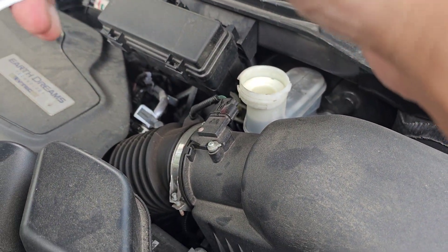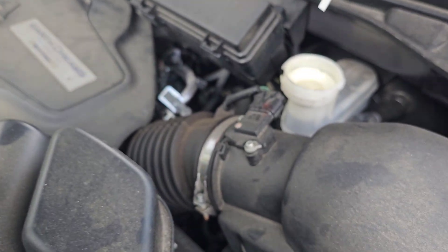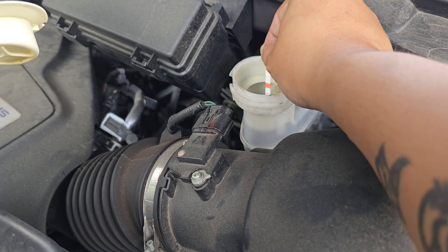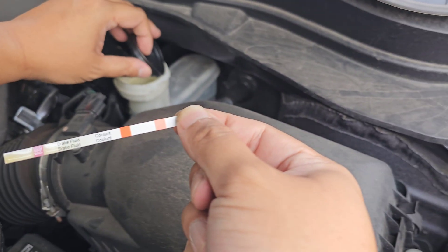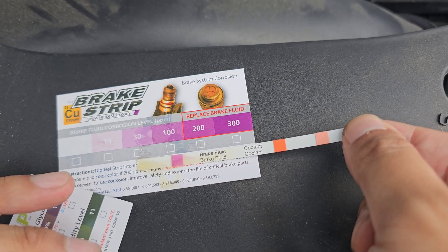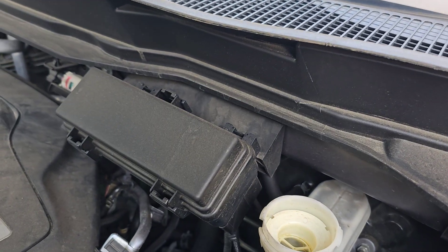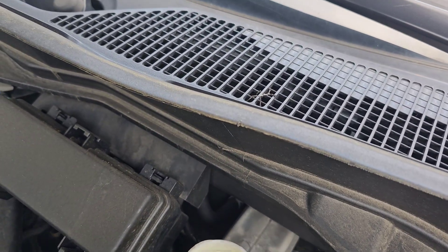At the Honda, let's get a brand new strip. Remember, the bottom white part is the brake fluid strip. This car has around 65,000 miles and I don't believe the brake fluid has ever been serviced. It's already turning pink that fast — it's almost well overdue. Comparing to the card — it's not even 90 seconds and it's already at 100 or possibly 200 ppm. The fluid looked pretty dirty too.